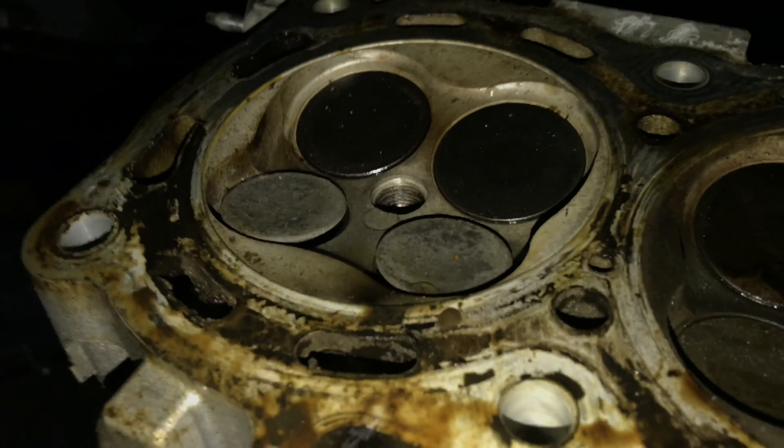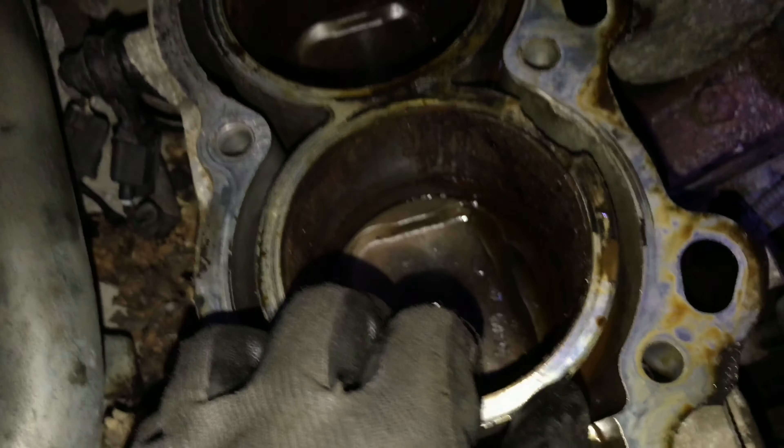Now, to get this head off, you've got to search the entire thing all the way around, looking for bolts and attachments. There are a lot of wires, cables that are strapped to it. I have it loose, but I can't quite get it off because this exhaust manifold is still on there. So I had to pop that off, go underneath, get all the bolts off of these studs, go down, get one bracket, one rubber piece, and two exhaust clamp manifold bolts. So I got the head off. It's actually not too heavy — easily lifted out of there.